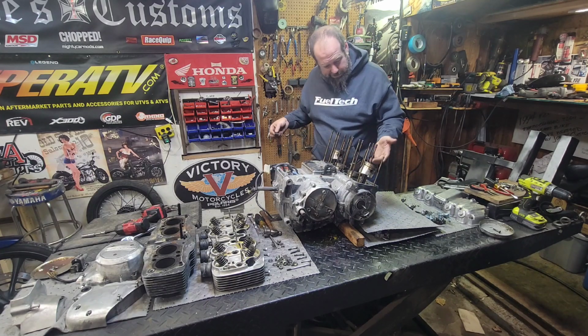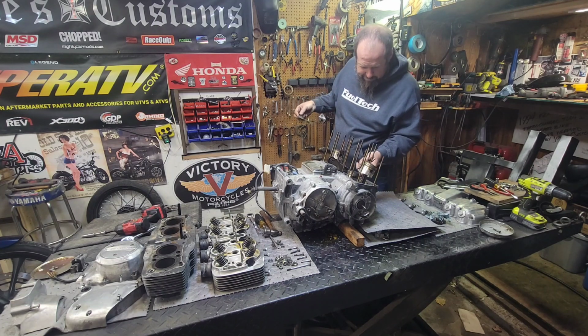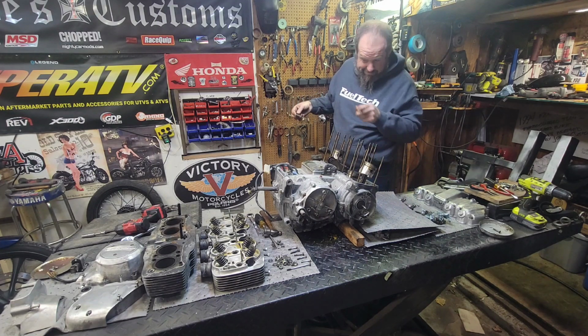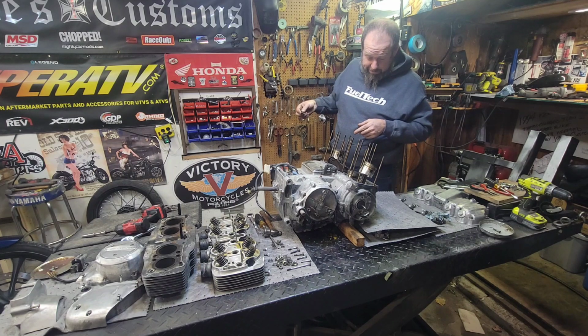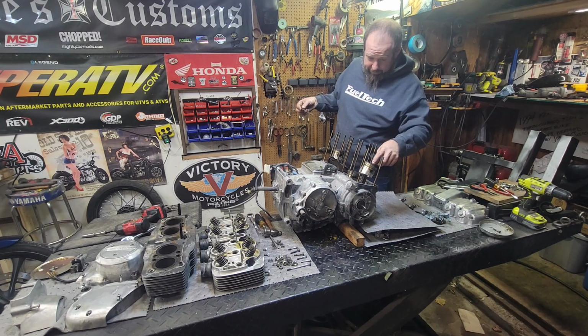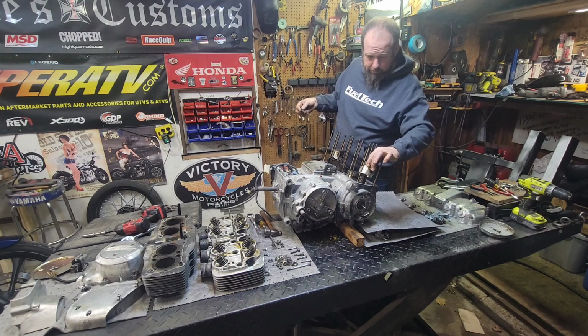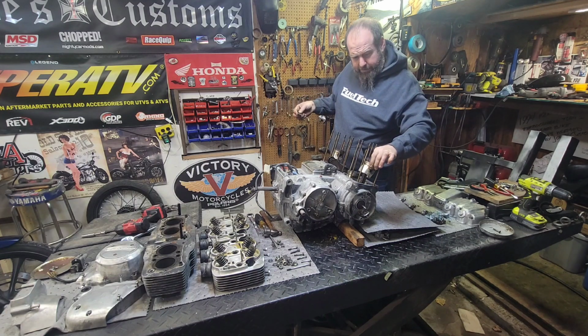Man, almost could have just cleaned this thing up and ran it. But I'm going to swap this stuff. May bore it out a bit. Put some new sleeves in it. Definitely going to put some different pistons. Bigger rods. Open these ring gaps up a bunch, because they're nice and tight. Going to open them up for boost.